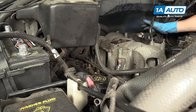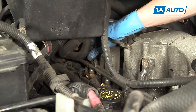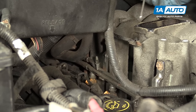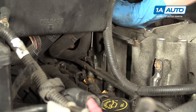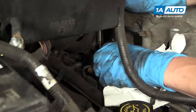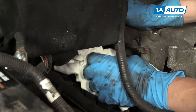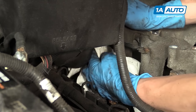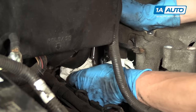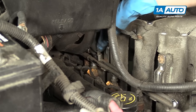We're going to be disconnecting the fuel lines momentarily, but we want to make sure there's no fuel pressure in the fuel rail. Back here on the passenger side, there's a little Schrader valve with a cap on it. Pull the cap off, and then — wearing safety glasses and protective gloves — we need to release the pressure by pushing down the little Schrader valve, just like a valve stem on a tire. I'll cover it with a rag and a screwdriver and push it down. Looks like there's not much pressure in there. Now I know there are no surprises when I disconnect the fuel lines. Put the cap right back on the Schrader valve.